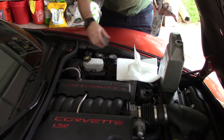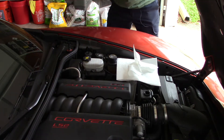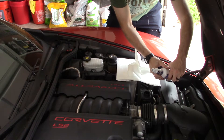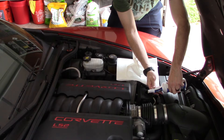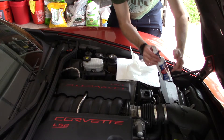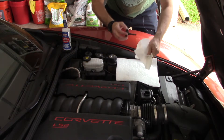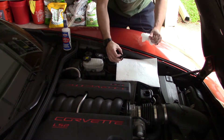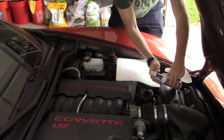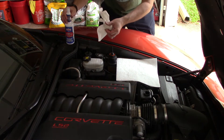It doesn't take a lot of fluid. We'll cap the old fluid and get it out of the way before I dump it all over the place — I am kind of messy. A funnel will work, but if you just go slow and easy you can pour it right in. If you look down the hole you can actually see the fluid level inside rising. And if you get it a little too full, you have a fluid extractor right there that you can use to pull some out. We'll add more and check the dipstick.